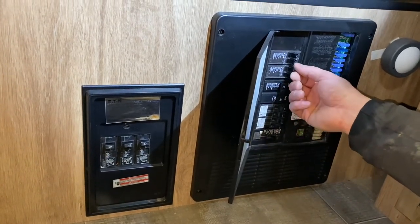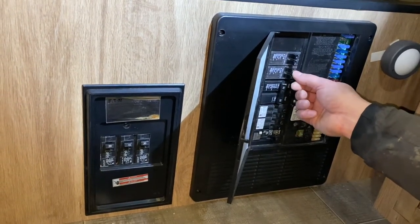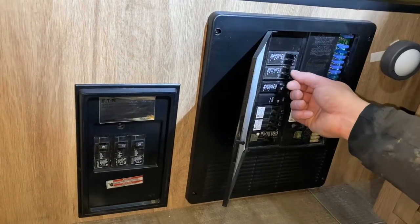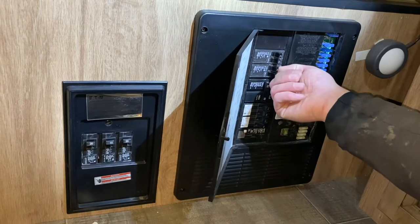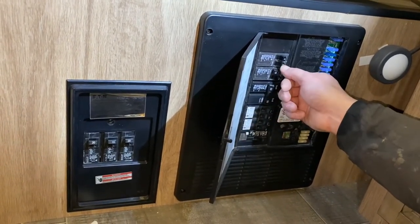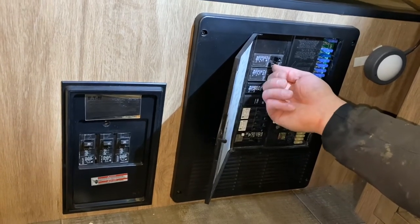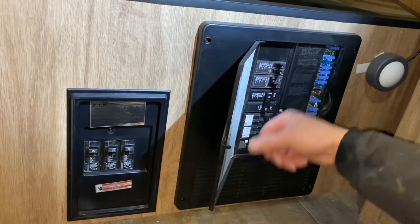So that's all the advantage of the EasyStart, which I plan to put on the back as well. The run amperage was minimal — I think we should be able to get several hours at four to five amps of run amperage for that front HVAC unit. We won't be able to run both at the same time, so we could theoretically turn the back one off and only run the front one during the day. At night, we can run the back one by the bedrooms and keep the front one off. Let's go ahead and test the front one.